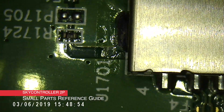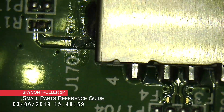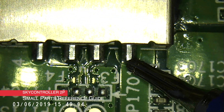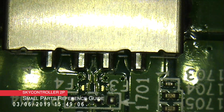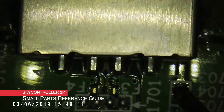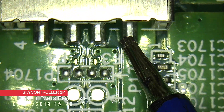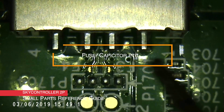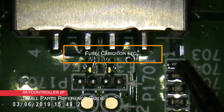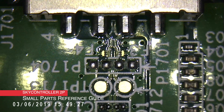There's not much difference to them if you're soldering. Even with a small soldering tip — I'll just use this to show you how big it is. That is a T5, so it's pretty small. And you can see how, even with a small T5, how small those components are. See that fuse is really small — smaller than the tip of the T5. So you have to be very careful when you're soldering them in.